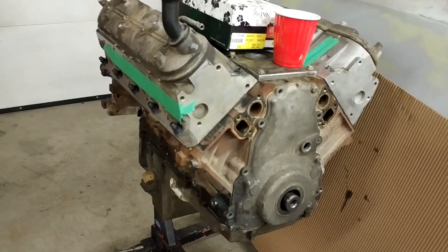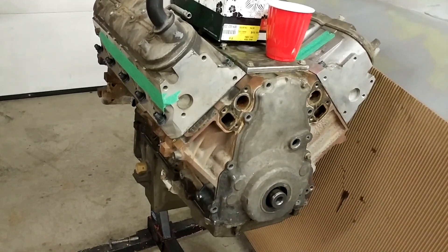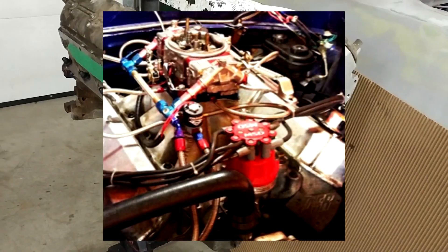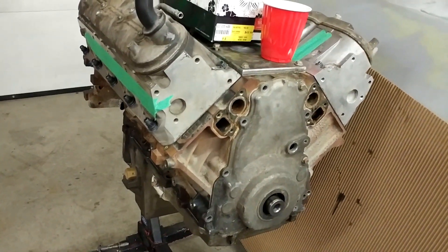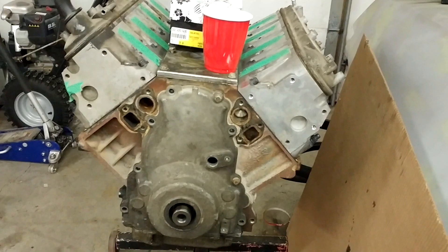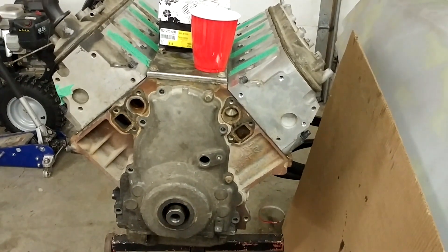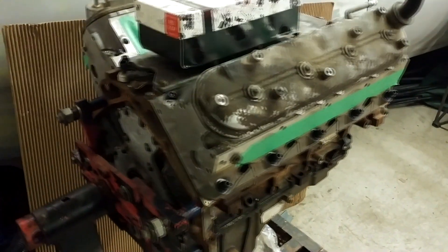Being that it's a Gen 3 motor, my expectations for horsepower aren't super high for this one. I'd be happy with like 550 rear wheel, 600 to keep it safe, and maybe a big tune in case I need it for track or whatnot. The small block forced-induction motor that came out of my Mustang made 523 rear wheel horsepower on motor, so if it's around 550 it'll feel alright. I was really counting on this motor being a Gen 4, but it was super clean, so even though it's a Gen 3 I figured I'd keep it and use it for now. Eventually I'd probably like to get a 6 liter and do forged rods and pistons, maybe rotating assembly, and then really push it. For now, it'll just be nice to drive my Mustang again.